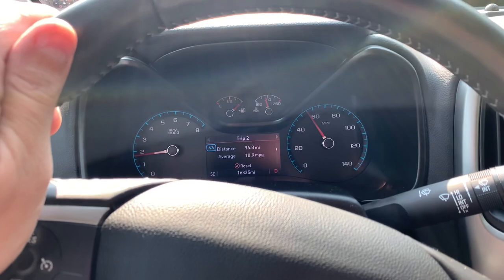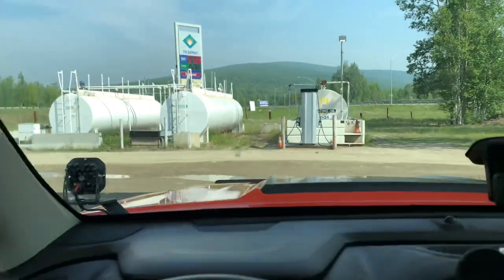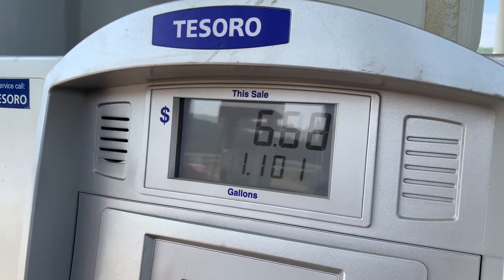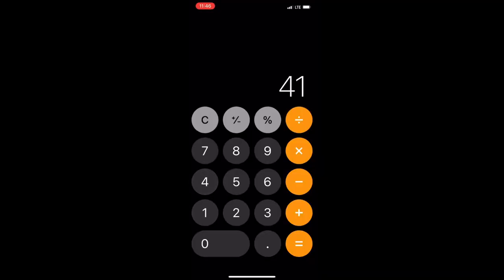Here's where we're at almost halfway, and here we are almost finished — V4 mode again. That's 28 horsepower and 41 foot-pounds of torque. Do you think we got better or worse than stock? Here we go — first pump, wait 30 seconds, pump again. That's 41.6 divided by 1.887 gallons. That's a 3.5 mile per gallon increase even with a horsepower and torque gain.